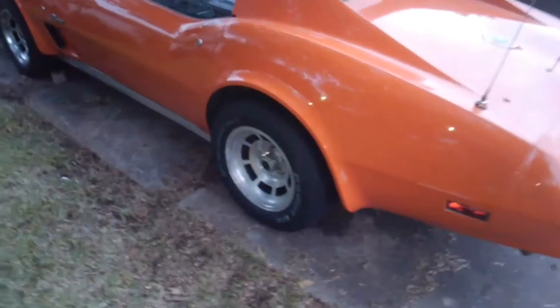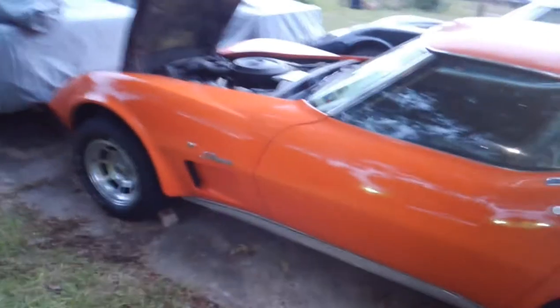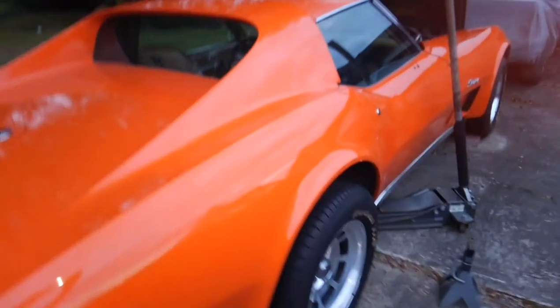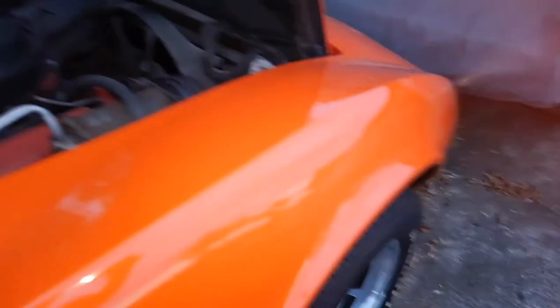We're back with the finished product — car is back on the ground, bled, and we're going to take it for a little road test. This concludes our video on troubleshooting C2/C3 Corvette braking systems. Nine times out of ten you're going to have an issue with the caliper itself leaking fluid. If you get into one of these older Corvettes or are buying one, make sure that's the first place you look if the brakes don't work — if there's no fluid in the reservoir, it had to go somewhere.